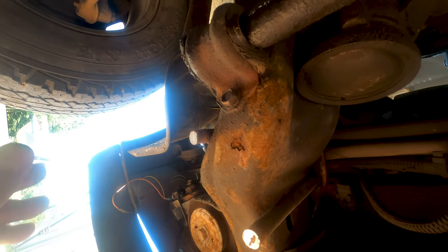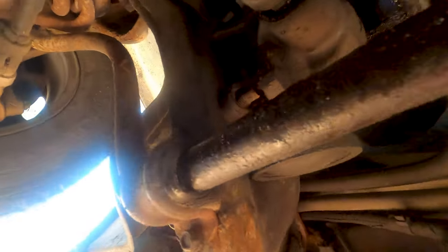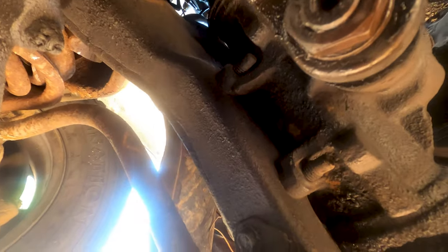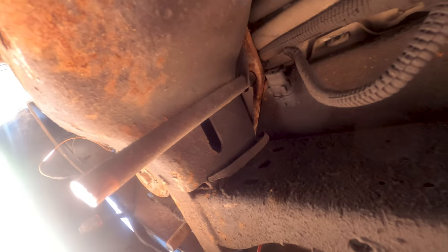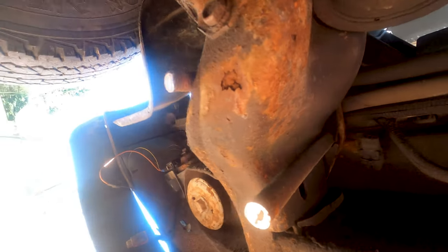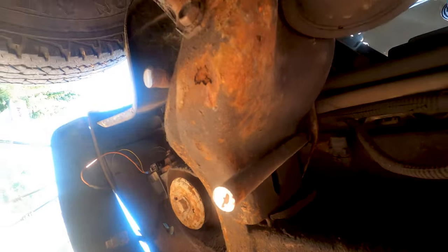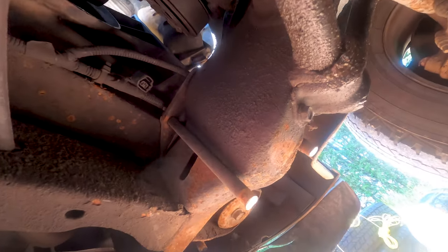I mean, it's not as bad as I was thinking. This side's got a fair bit, but it always seems to be the steering box side. Luckily the steering box mounting portion of the frame is still in really great shape because it's been covered in oil — that was the problem on the blue truck as well. The only challenge now is we have no way of getting the rest of these brackets off without taking the whole front end apart, taking the rad support off. So maybe they're just going to stay there for right now.